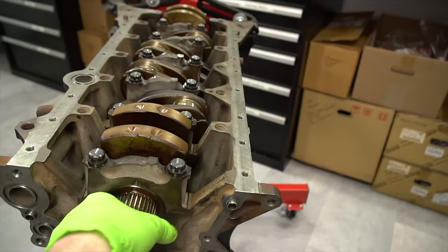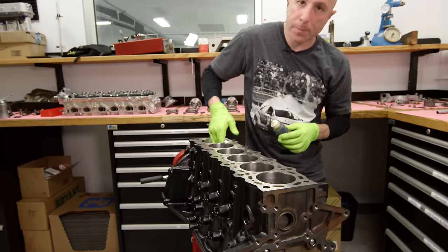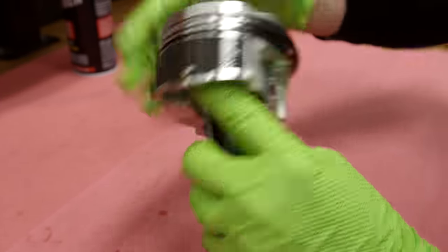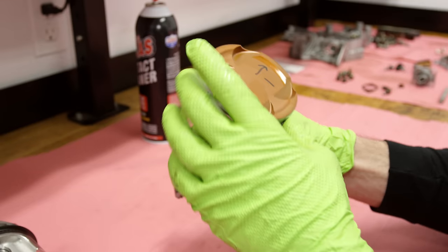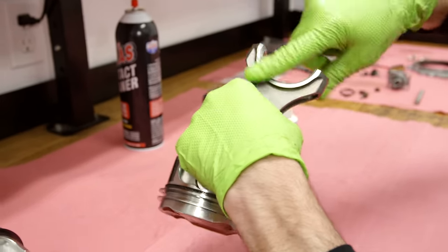Now it's time to install the pistons. The cylinder walls are all nice and clean, and then we're gonna put the piston ring lube on them. I'm also gonna put some piston ring lube on the skirts of the pistons and the rings. Next I'm going to align all of the piston rings because the gaps need to go in at specific angles — this varies depending on the engine manufacturer and even the engine builder. I always like to hold the piston with the exhaust valves pointing towards me so it can be consistent on each piston when I align the rings.